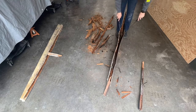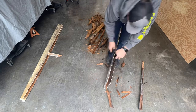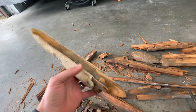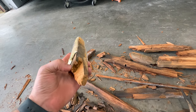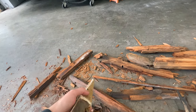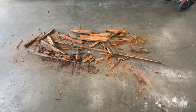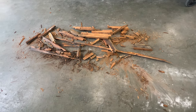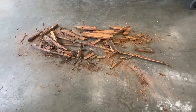I'm pretty shocked that it was this bad. I knew the stringer was rotted, but once I popped it out and saw how bad it was, I had to show you guys. This is the front section of the stringer — my stringers are 16 feet long and it was rotted and just broke apart. So it was waterlogged and rotted all the way from the back to 16 feet forward in the boat. This has clearly been rotted out for a long time. I could not even imagine it was this bad when it was in the boat. I thought it was worth grabbing the camera and showing you guys because I think this is about as bad as it gets, honestly.